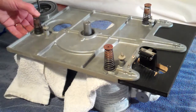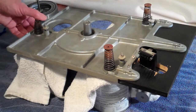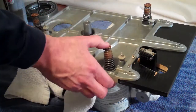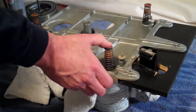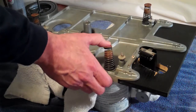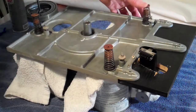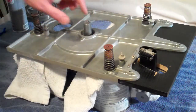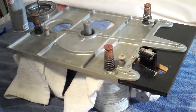These springs are all supposed to have their easiest bend towards this center well. So if your spring did fall out, when you reinstall it, just make sure that the bend in it — the easiest point of bending — is pointing in towards this well. And that'll help it to sit nice and centered.